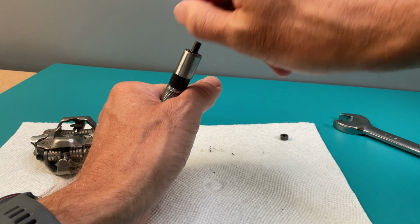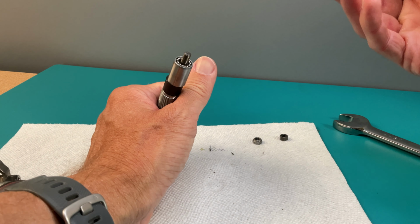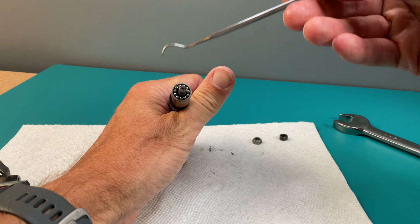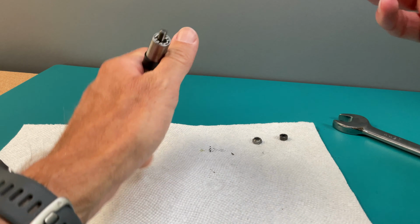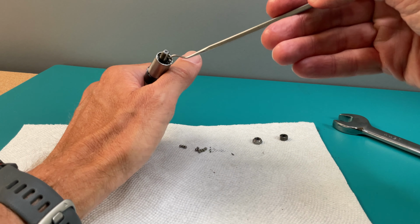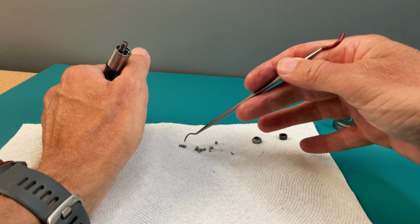With the lock nut off, be careful to not raise the silver bushing. This way you won't dump the inner bearings too early. The 9100 pedals, and maybe the 9000s, I'm not sure, use a thinner axle allowing a reduced stack height compared to other Shimano pedals. Due to this, the XTRs use 11 bearings on both the inner and outer compared to 12 bearings in most other models.